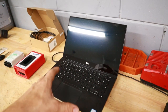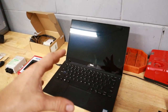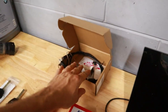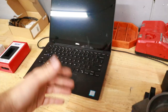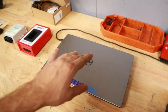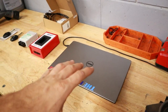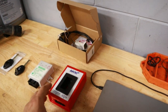The first thing you're going to have to have is a Windows laptop because the AK90 software is only going to work with a Windows machine - something with a USB port and an internet connection is really all that you need. The AK90 comes with software on a CD, but in case you can't load that - like mine doesn't have a CD or DVD drive - you can search online. I'll put a link below where you can download the AK90 software completely free without needing any account, and it's really easy to install.